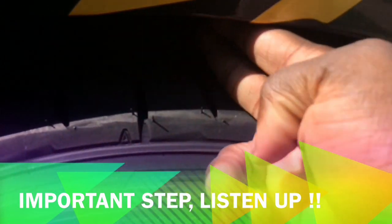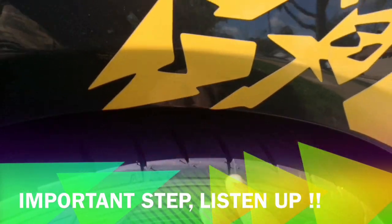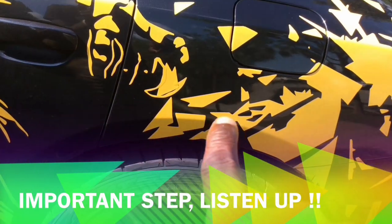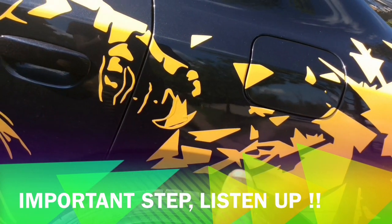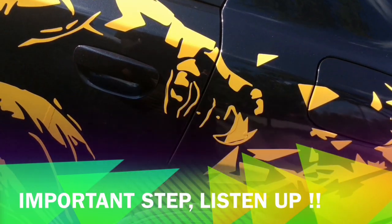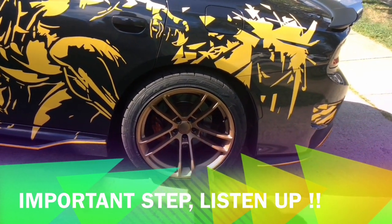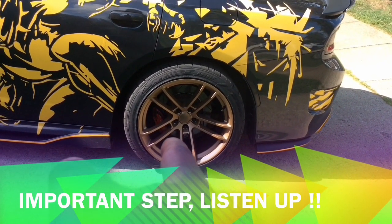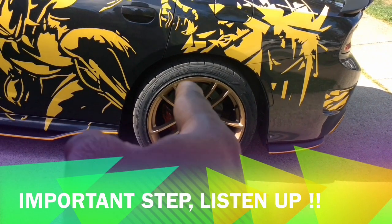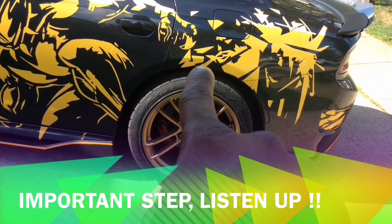Look at that. Barely, you can't put three fingers in there, two fingers. So you put two fingers in there, and I got a little space between them. All right, so the reason people are cutting on the fender is from here, cutting almost to that fender line there, just a little bit shy of it, and then folding it over. The reason they're doing that is because you want to have enough wheel space, so that if you hit a bump or something like that in the road, which would suck, of course, you know how it feels, your wheel doesn't actually hit the fender.